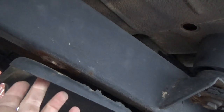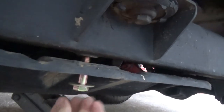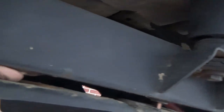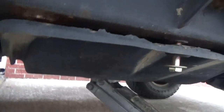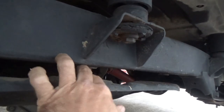I've already taken the three bolts out here, here, and there. For safety, I've partially threaded a half-inch 13 bolt — two and a half inches long, which is the thread size for these — up inside there to support the transfer case. I need to drop the jack down just a little bit more to get the washers inside here, so I want that bolt to help support things as I drop the skid plate down.